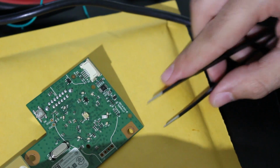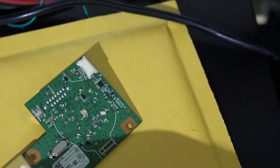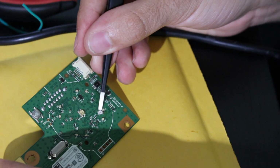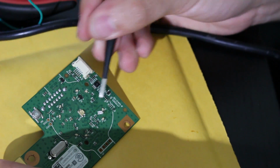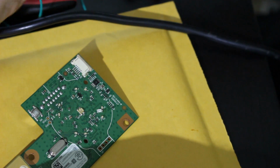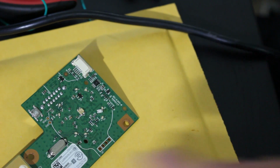So this right here is actually exactly what we're wanting. What I did was I got it soldered in. That's not touching the other LEDs, that's good. And what I'm going to do is just poke that a little bit on each side, and that thing's not moving. So we now have the negative point soldered in successfully.